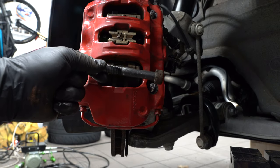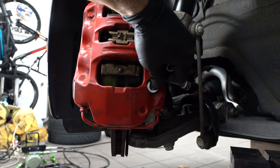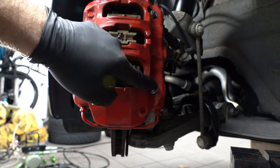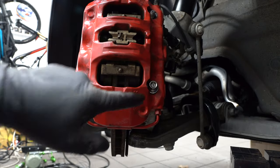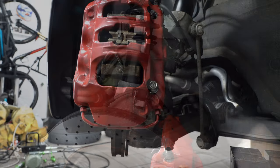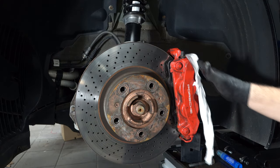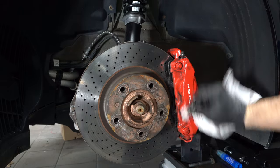Normally at this stage you will be replacing your bolts, but since we're using the stud conversion, put a washer on first and then put on the nut. We cannot tighten it just yet because we have to wait for the Loctite to dry for about 20 minutes — I'm going to leave it overnight — but once it dries we'll tighten it to 56 foot-pounds. Don't forget to replace the 10 millimeter bracket bolt. And that's it for the front — that's how easy it is!